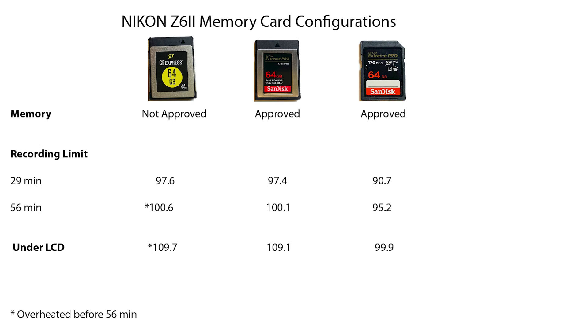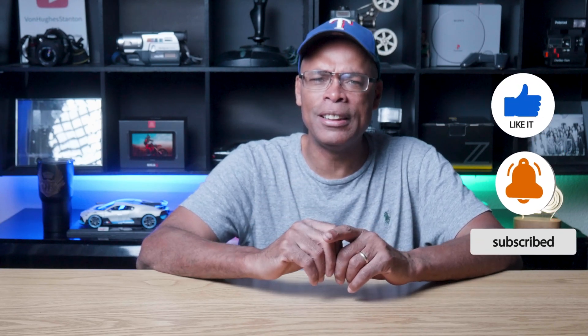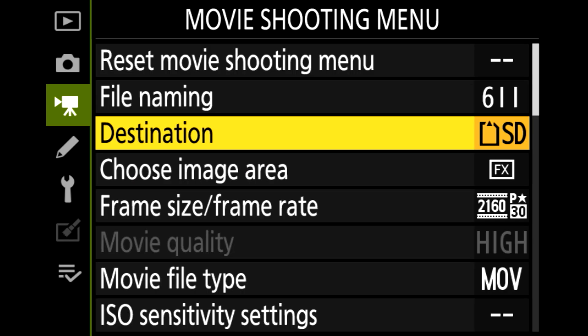Here's a comparison of the different configurations. The takeaway from these tests is that the generic battery was creating the most heat at 107 degrees across two cycles. The generic CFexpress card minimized recording time due to heat from not handling the required speeds. The processor and memory cards were adding to the overheating in all tests, so you have to factor that in. Swapping the SD and CFexpress cards as primary gave me an additional 5 to 10 minutes of recording time. You can go into your camera's menu to change which card is primary.